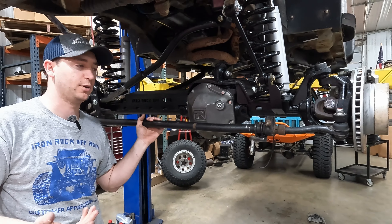On the driver's side we have a tapered sleeve already installed in the pitman arm — small side goes in. Unlock your steering wheel so you can move the gearbox as needed. We had to push it over just a hair to clear. Drop the bolt in, then add a misalignment spacer, heim joint, another misalignment spacer, washer, and castle nut.